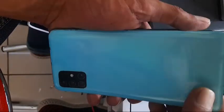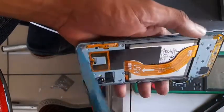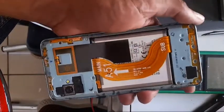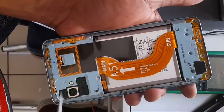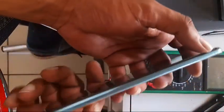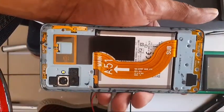It wasn't that difficult. You can see it's been replaced before — screws are missing. So we're going to open the screws, but before we do that we must remove the SIM reader, because this one is going to come out like that, and then we're going to remove the front LCD.